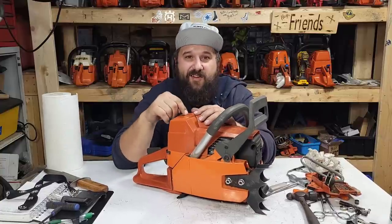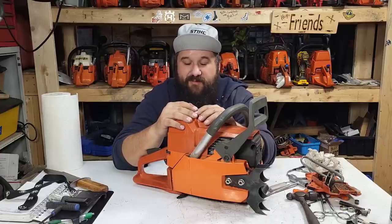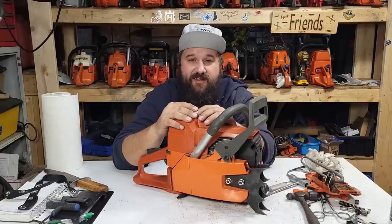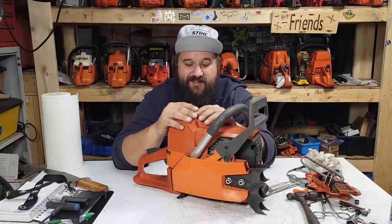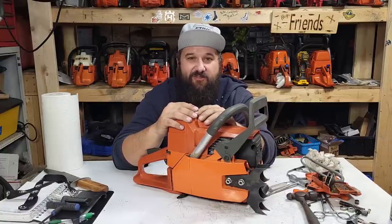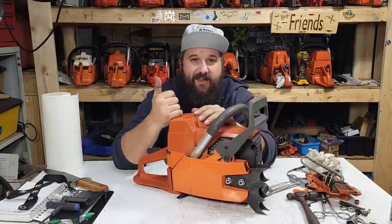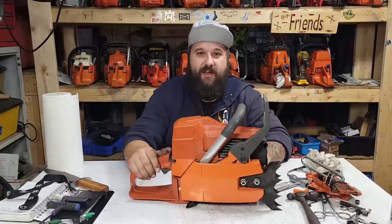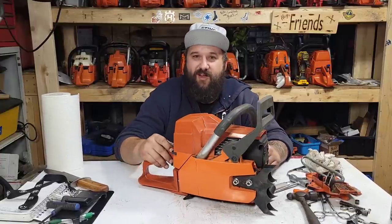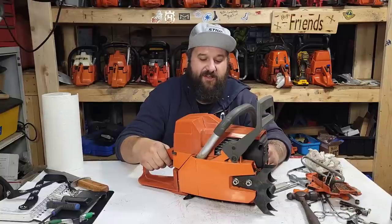The bearings in these saws, they feel okay, but they aren't marked, friends. There's no maker name on the ones in my saws. They're just 6203. There's no speed rating. They're not C3, which is the tolerances. I don't trust bearings like that, friends, especially ported. You're putting more power and more abuse through them and more RPM usually. So right there, I can't port one of these with the stock bearings. I just won't do it because that bearing's going to fail probably pretty quickly.